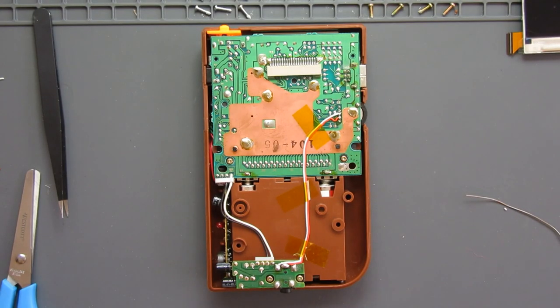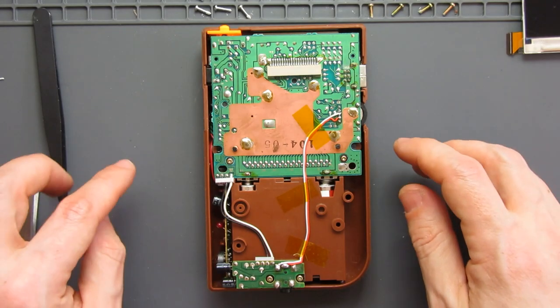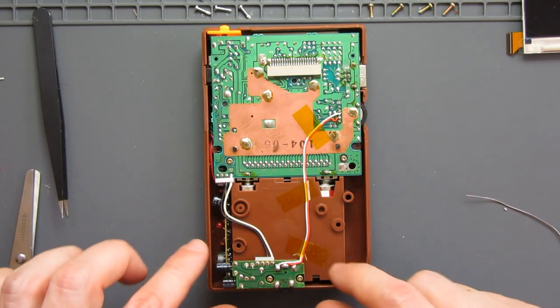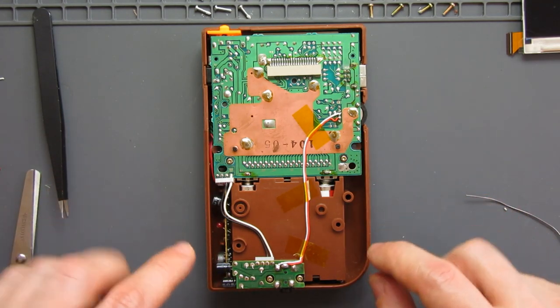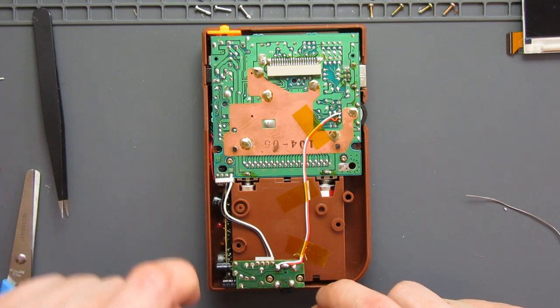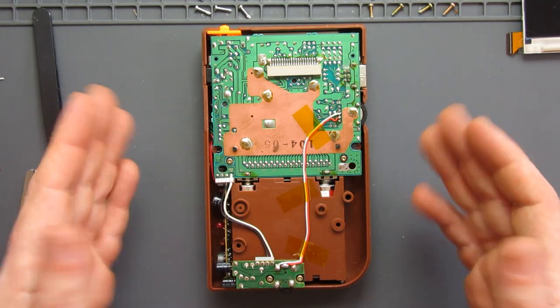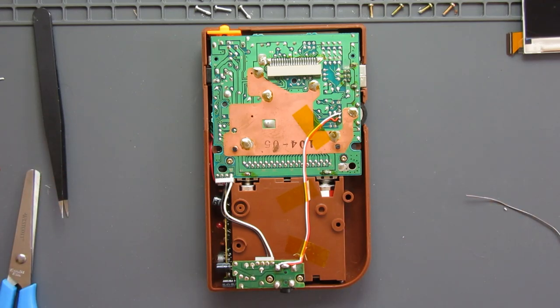All right, so that's now all together. The back panel is in place. We've trimmed the bit we need for the other potentiometer afterwards. That is all screwed back in place, everything's secure in here. I've taken out the two wires from the left, replaced them with these two on the right going up there. Everything's neat, everything fits in place. So now we're ready to set up the front panel.